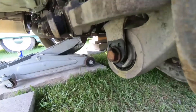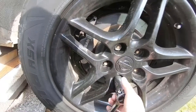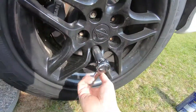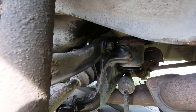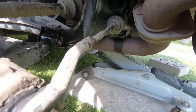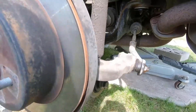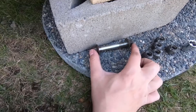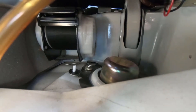Here's what the bottom of the coilover looks like. The GTT has a fork-style rear coilover — make special note of that. Juca Racing, when they got the coilovers for me, didn't know what style it was at first. To take the wheel off it's 21mm. Hit everything with WD-40 — it doesn't hurt. I'll be taking all that stuff off; there's the rear hicas assembly also coming out in this video. The 17mm bolt on the bottom of the coilover isn't too hard — just double-wrench it and reef on it.